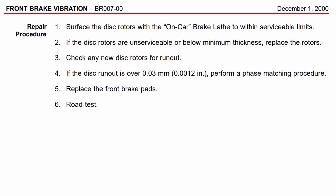So now we know what the problem is — what is the solution? In my case, and probably most of y'all's cases, the solution is to perform a full brake job. That's brand new rotors, or machine them with an on-car brake lathe, which I do not have, but Toyota recommends and we used to use at the dealership. And new brake pads, because the pads themselves have been negatively affected by the warped rotors. In my case, I know the problem was partially caused by the fact that I used really cheap rotors to begin with — they were on sale.